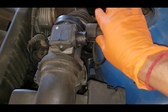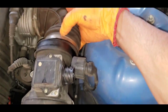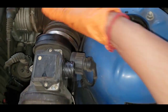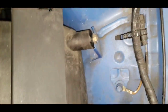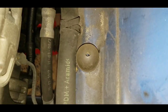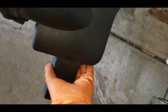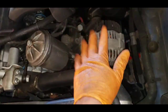This comes out - the plug on this side, just loosen the clamp, then pull this out. This bracket right here, just loosen it and you should be able to take it out. That part lines up with this piece right here on the bottom, so it's very easy to get out. And as you can see right there, there's the alternator.